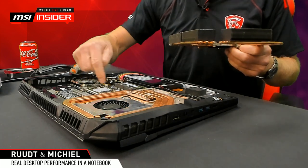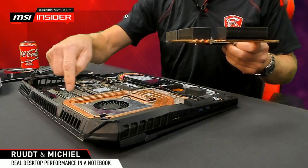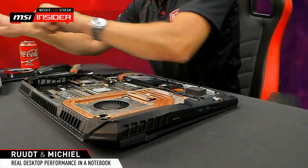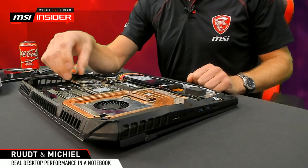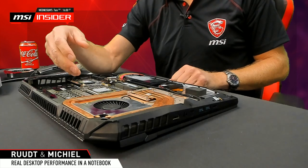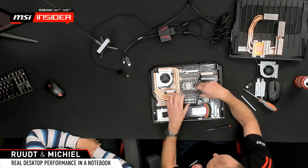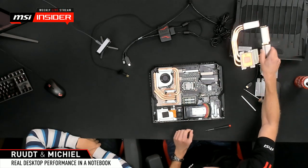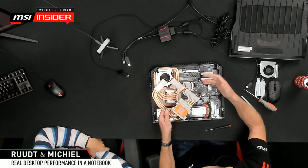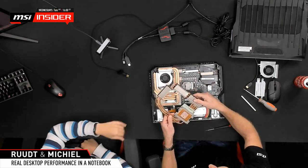So yeah, this part will cool. This will produce like 207 watts, but this is also losing some power because it's not 100% efficiency. And that will equally also do maybe 10 or 20 watts of wasted heat. So this cooler alone needs to take care of about 220, maybe 250 watts, something like that. That's also why it has a lot of heat pipes and heat sinks.